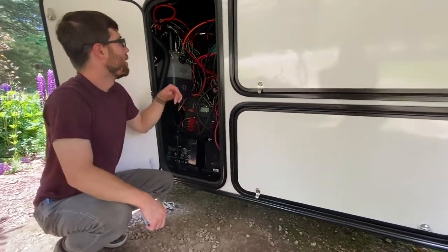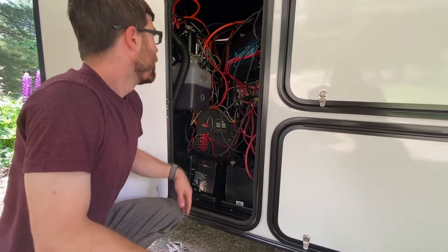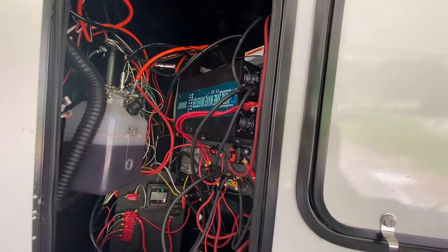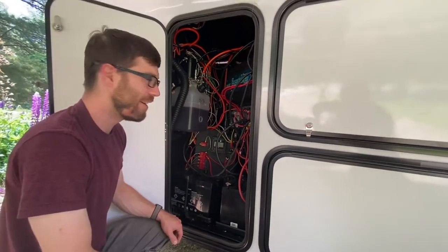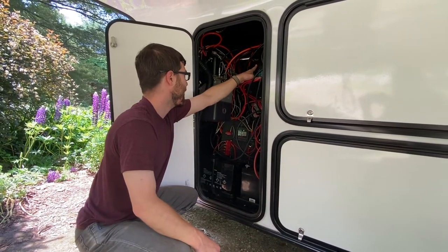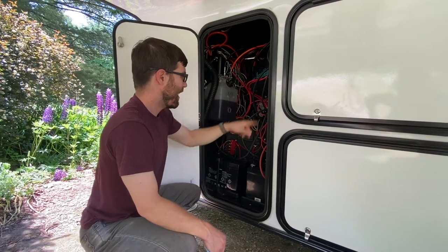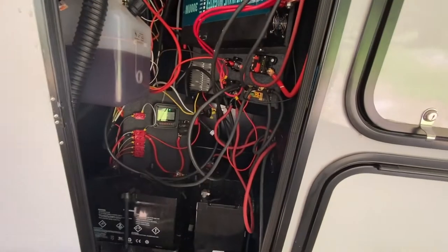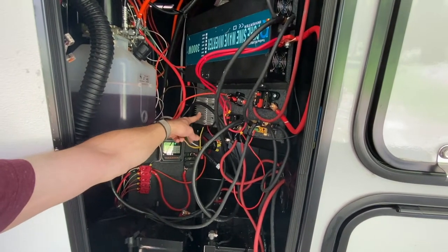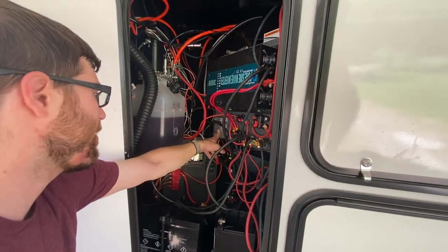If you come over here, your other two batteries are wired in series and then tie in with the others in parallel. We have our upgraded inverter — this is how we can run all of our AC appliances off of our battery bank. The RV only came with a 1000 watt inverter, and it was wired so it only ever powered the fridge. If you wanted to run anything else, you're out of luck. We pulled all that stuff out and now have a 3000 watt inverter, which can run just about everything we need from our battery bank. We also have a battery monitor — there's a screen up in the bedroom that shows how charged our battery bank is. Some breakers so we can turn things on and off. And this is the DC to DC converter: the RV wants all of its DC stuff to run off 12 volts, but our battery bank is 24 volts, so this drops it from 24 to 12 and feeds into the rest of the system.